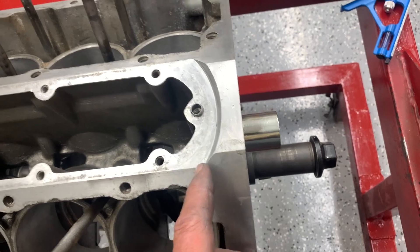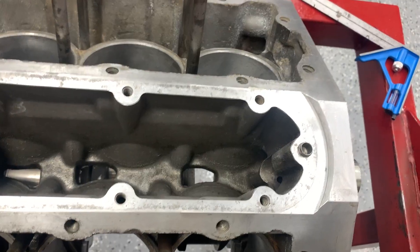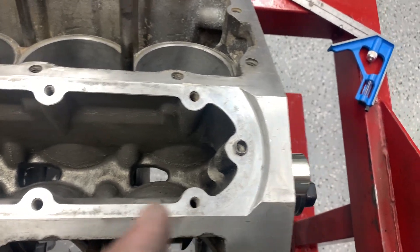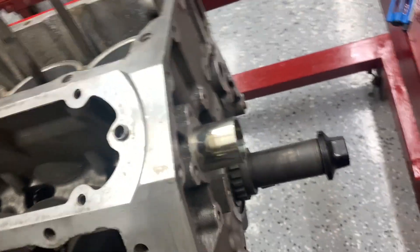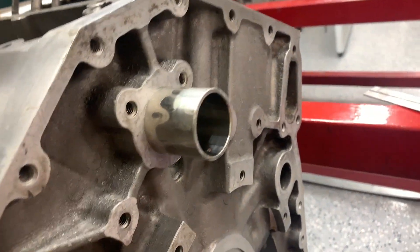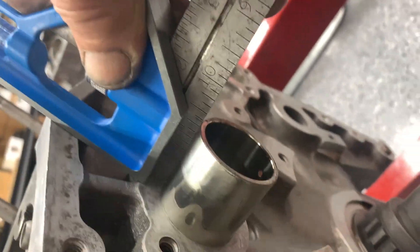For the front bushing, however, we would have to insert the bushing from the rear, and that's just not a good way to get it started properly — making sure it's straight. Up front you've got all sorts of places you could put a square. This whole front of the block is cut off flat, so it's an easy matter to take a square.